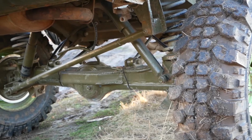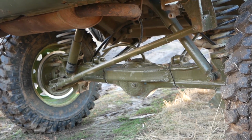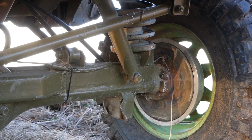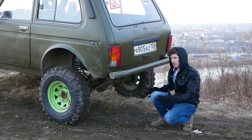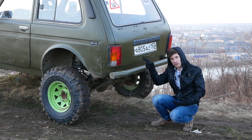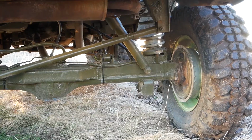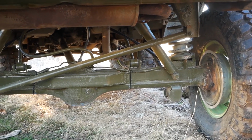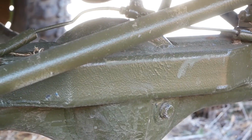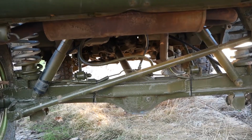Rear suspension springs and shock absorbers remained stock. 10 cm or about 4 inches spacers were integrated for lift. Panhard rod was increased by 4 cm or about 2 inches so that the rear axle remained straight with the lifted SUV. Large and heavy wheels give a higher load to the axle, which can break. Therefore, additional metal profiles were welded onto the axle from both sides.